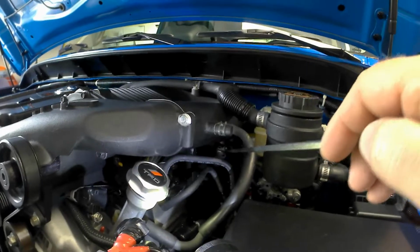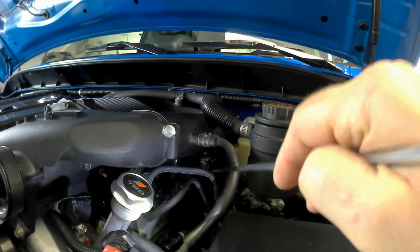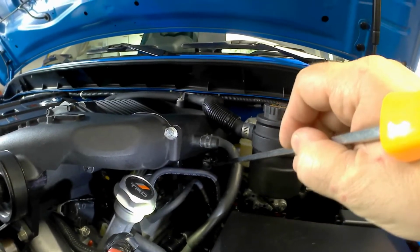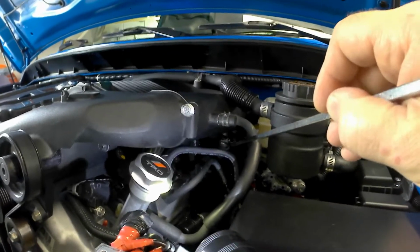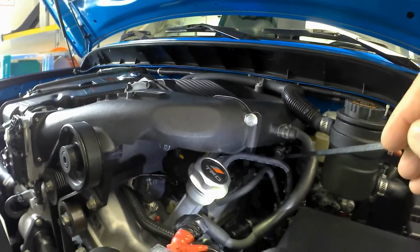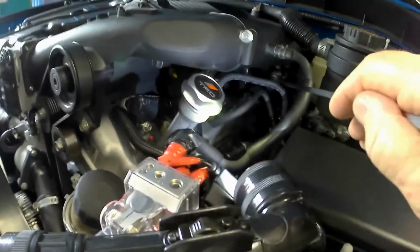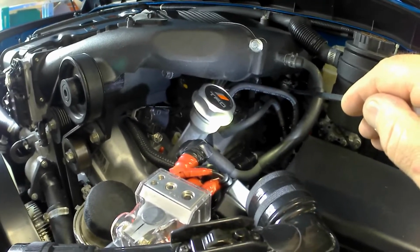I don't need it. I have an SFI. I'm not sure about the newer FJs before they stopped shipping them. They're still making them. They're sold all over the world, well, not all over the world, but about half the world still. They're just not over here anymore. I have an '07 SFI. Double check your engine. Later on, they went to a different engine. The oil filter was in a different spot, it was a little bit smaller, and it was tuned a bit differently. But check yours. If it's a GDI, I would highly recommend doing a catch can.